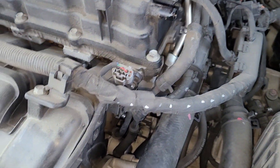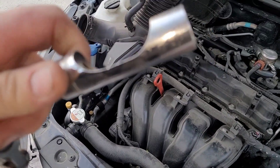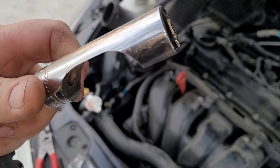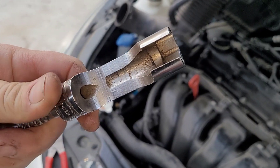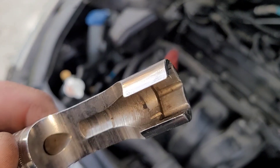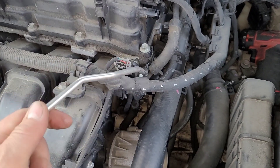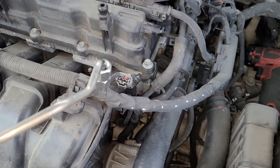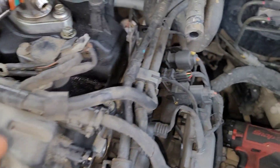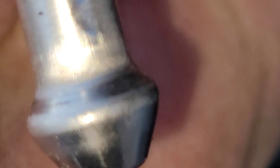Now let's see if I can snake this whole line out somehow. To get the bottom off, I used this socket here — this is a 19-millimeter. I actually got this way back in the day for when I was doing diesel injection pumps on 6.5 GM diesels on warranty. It helped get to some fuel lines of similar design that were just difficult to reach with a wrench. After some manipulation, got it to come out. I wound up taking this fuel line off and there was a ground strap there too. I could swear there was possibly a hairline crack in there — you're not going to see it in the video, unfortunately. But what else is there to leak? The end of the pump actually looks fine.